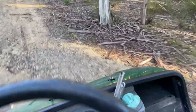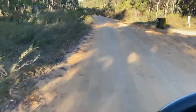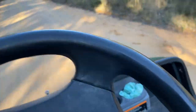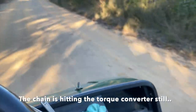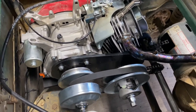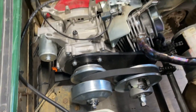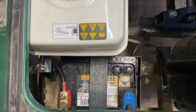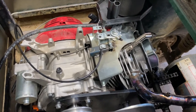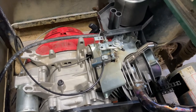I somehow got this thing running again. We did a bit of a pull test and got it back. It is running fairly good. I did notice the front torque converter was actually staying locked in — that's why we couldn't push it and why it wouldn't really start. I'm going to try and figure something out about that alternator. Also, this throttle linkage is just junk — none of it's going to work. So what I'm going to try and do is find a new carby, maybe off a motorbike, and put it on there so it'll have an actual needle instead of trying to do it this way.